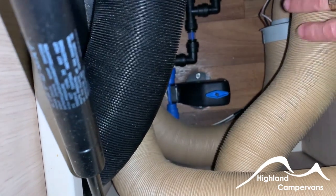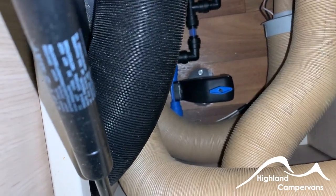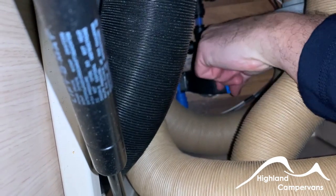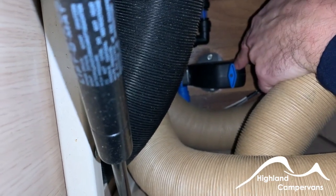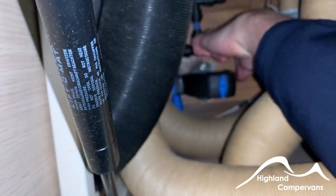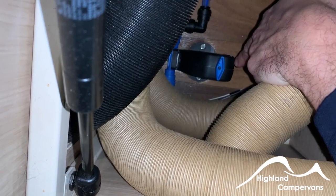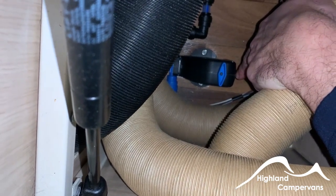On the bed box side by the power port, you've got your thermostatic drain valve for the water heater — it's a little obscure to find. The blue tap on the side currently open means the valve is open; if it's in the direction of the blue running pipe next to it, it's closed. To reset the water heater, make sure the valve is in the relevant open position. There's a little raised blue button that pops out and needs to be pushed back in for the reset to occur. If it doesn't push back in, you may need to have the running heating system on first.